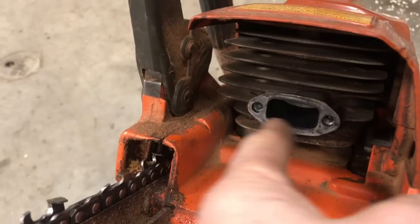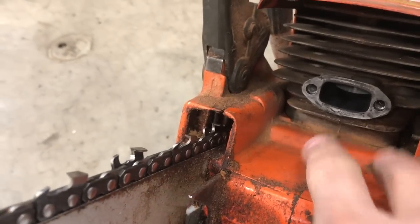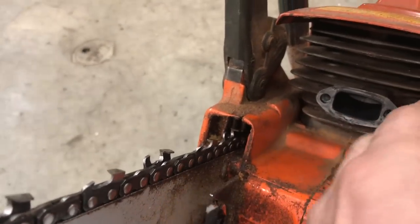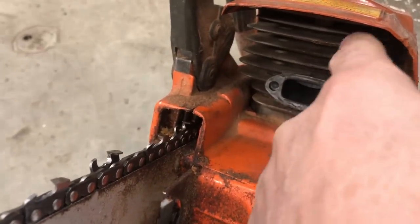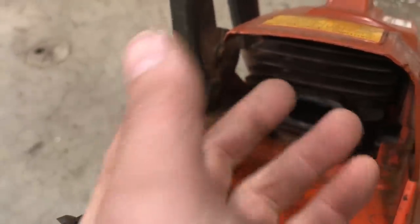The exhaust port just kind of dumps into the first can on the bottom. There's some shape to it, like it's directing. I got it curved so it directs the flow of the exhaust. I'll just flip you around and explain it on the saw here. So the first pipe that I built, with the two pieces of exhaust tubing stacked on top of each other, the exhaust just dumps into the bottom chamber, and it's got a curve to it like here on the side, and it comes up here and hits this side, goes up into the top can, and then there's a kind of a curve back on it, and it's got the pipe sticking straight out here.